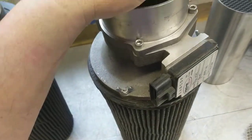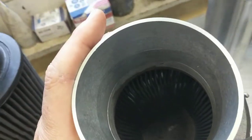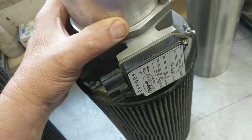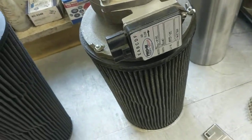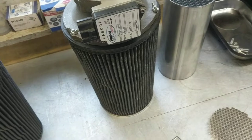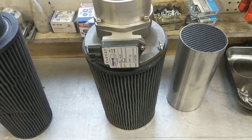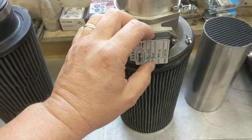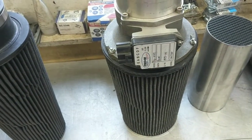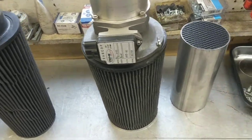They work really good but they're hard to find because once people get them, they kind of keep them — they don't want to sell them. You can find them on eBay, and Pro-M of course. I think you can get a new one for about 350 bucks, which is a little pricey, but for ease of installation, you get it programmed for your injector size and it's so easy — you don't have to put a tune in, you just get the tubing hooked up and go.